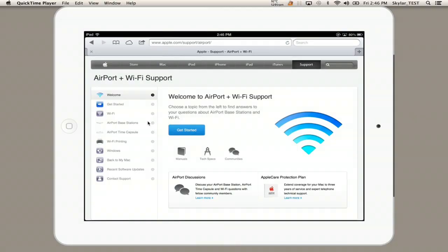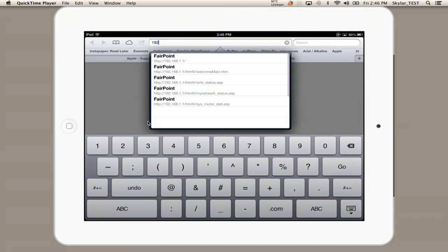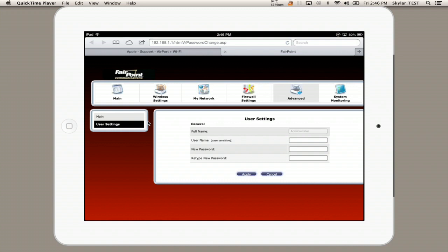If it's a modem, chances are the person who came to your house and installed it did most of the work. You can access the modem generally by typing in this address to your web browser: 192.168.1.1. This is the setup and control page for my modem — the DSL or cable modem that comes into your house before the Wi-Fi router which is connected to it.